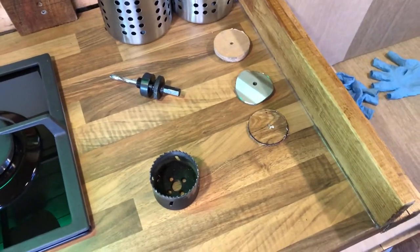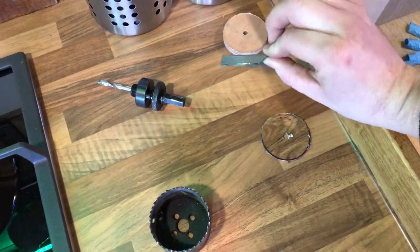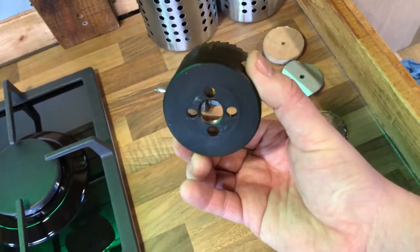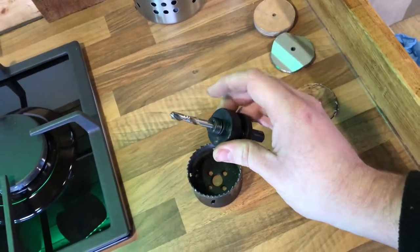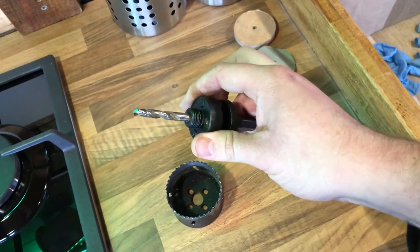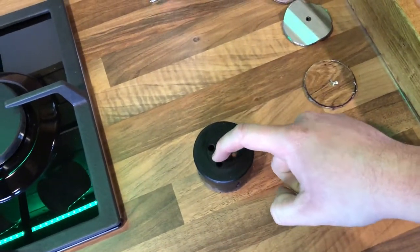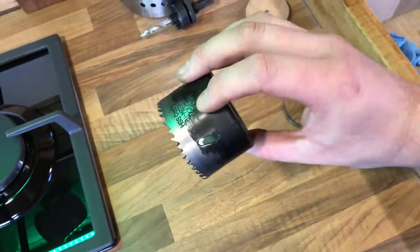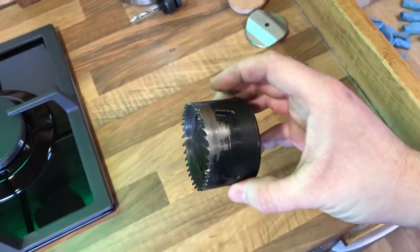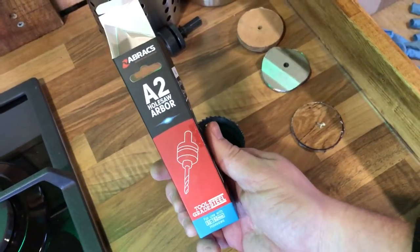I just wanted to show you the end result of cutting the hole — you're left with a piece of floor, wooden membrane, and also the metal bit out of the van floor itself. These hole saws are absolutely brilliant. In the middle you've got a threaded section and then you've got the adapter there. The way it works is you screw the hole saw onto this section, and if you spin that you end up with these little locking pins that come through, which stop it twisting — so rather than coming undone it locks in, and all the power from your drill is then used on the jaws for cutting the metal. I'll show you the packet so you can see the brand. These are available from Toolstation here in the UK, which is like a DIY hardware store.